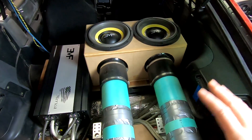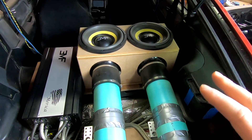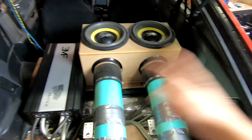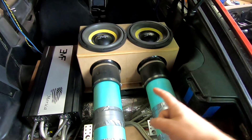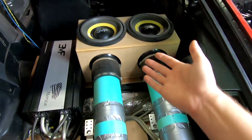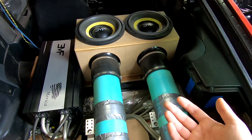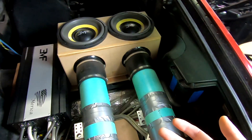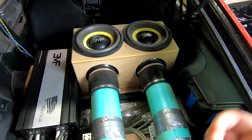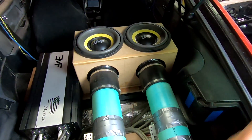So there's a big, big difference in the score in the port versus on the dash. I know there are a lot of people that every time they see a score — whether it's on the dash or in the kick — that they think is just way too good to be true, the first thing they do is say, 'that's a port score.' Well, as you can tell, there is a 16 dB difference near 2,000 watts in this particular application. It might be slightly more in others — odds are it's not going to be much less. Every time I've taken a port number, it's much, much higher — anywhere between 15 and 20 dB higher in the box than it is in the car.